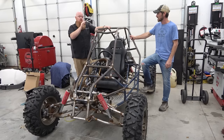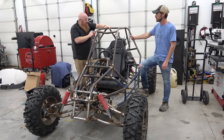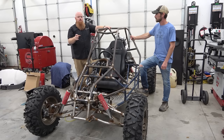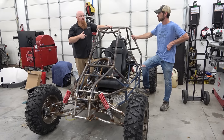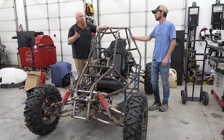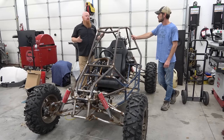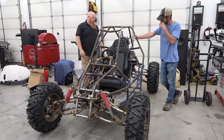Yeah. That'll be nice, because the front sprocket's a 15 right now. We got 60 on the rear. I can go up a little bit bigger on the rear, but it's going to be much easier just to pull the engine one off. So I can go down to a 12, which is already ordered. That's 9 more teeth equivalent on the rear sprocket. Right now it takes off in first like you'd want to take off in second. Yeah. 9 teeth is going to fix that for sure.